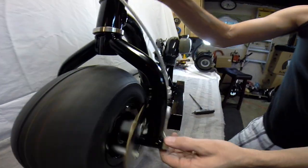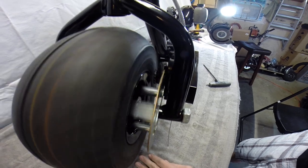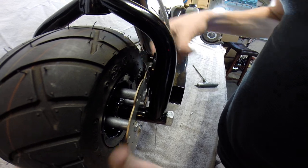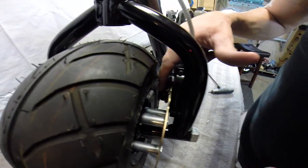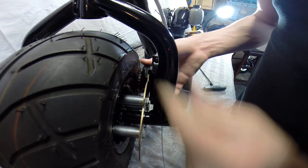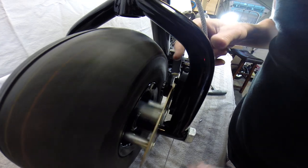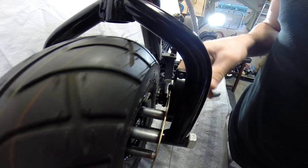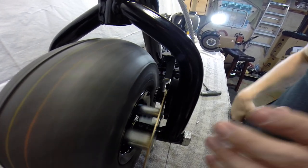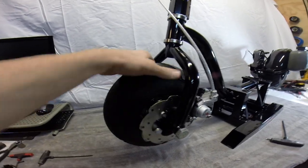Go ahead and spin our wheel. You can hear the rotor tapping on the pad a little bit. Let's go ahead and hit the brakes a couple times to realign everything. Now you don't hear it hitting anymore. There's a little bit of gap between the rotor and the pad. This little dial right here — you can adjust that, move it to tighten it up accordingly. One more notch and I can hear it tapping. If you listen closely you can hear that light scraping, but the wheel is spinning perfectly smooth with very, very little drag.